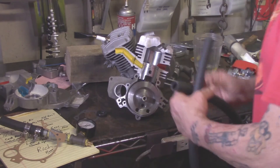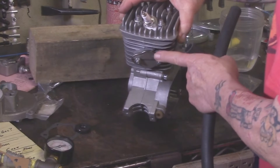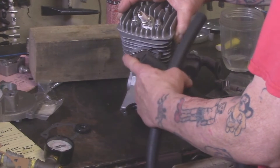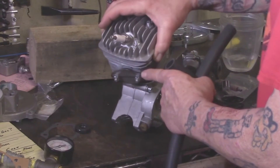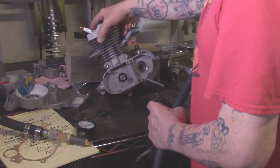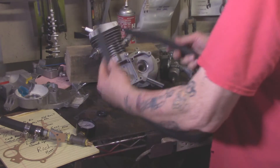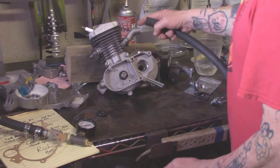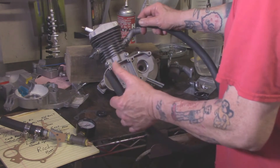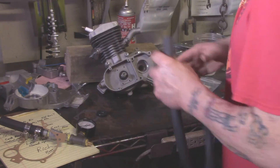Let me show you how you can test those using a rubber hose. I've blocked off the exhaust port on this engine using a piece of one-eighth inch steel cut bigger than the exhaust gasket, with holes drilled in it to blank it off. What we're going to do is pressure test the engine and see where it's leaking. You get a three-quarter inch inside diameter rubber hose that fits over the intake, put a hose clamp on it, and simply blow in on the other end to apply pressure.